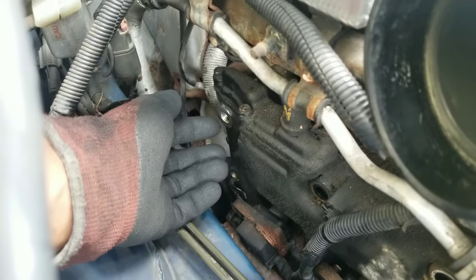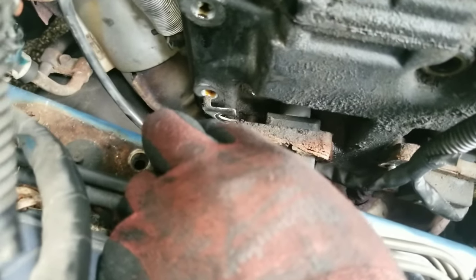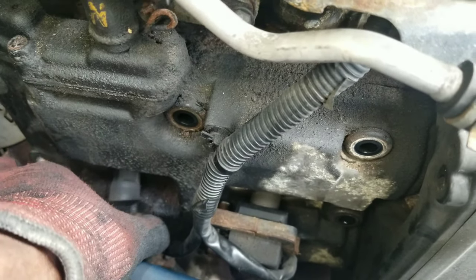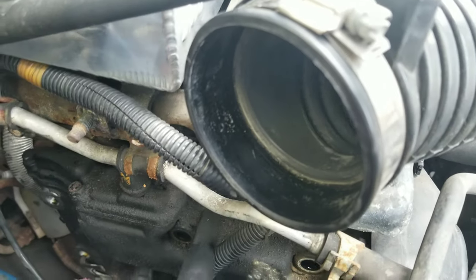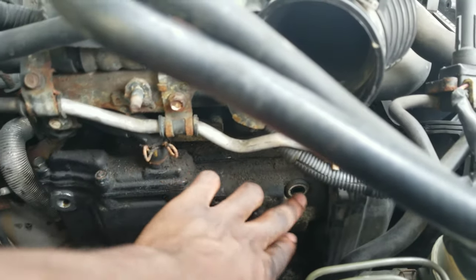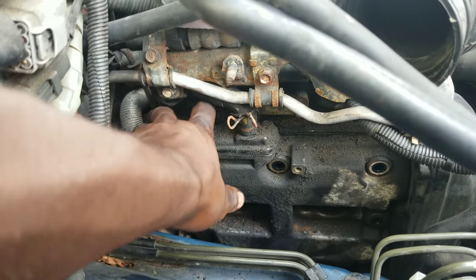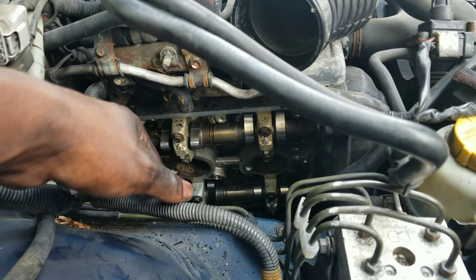You just got to go ahead and take out these eight 10-millimeter bolts — one down here, one over there, and there's gonna be one all the way down at the very back. You take your coil packs out, which isn't very difficult — I already got those out. Then once you have those out, you're gonna take a pry bar and just pry this off. We'll clean the valve cover. Once you've got the bolts out and your coil packs removed, you're gonna want to take this hose off.